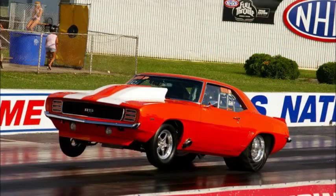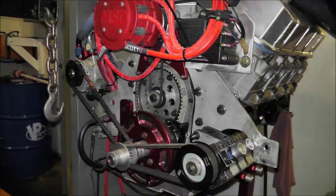The third type of drive is the belt drive. Belt drives are used primarily in upper-end caliber cars like NASCAR, all your pro stock drag racing — all those guys use them. They're best suited to control harmonics. We also use belt drives for some bracket racers and drag racers. Drag racers and bracket racers are terribly hard on timing chains because of the two-step — they push a button, stomp the throttle to the floor, the engine comes up to a rev limiter and holds it there before they launch, and it just shakes the daylights out of the engine. We've had issues where they break the links on timing chains; the belt drive has solved that. If you use a belt drive like a Jessel or a Comp — there are several brands now — that solves the issue and they work flawlessly.